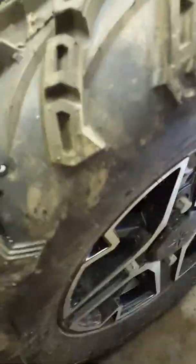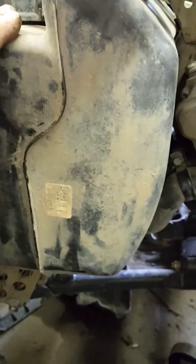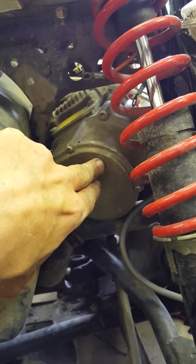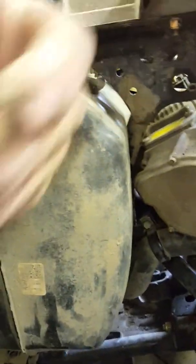I don't think I mentioned it in yesterday's video, but you definitely have to take the tire off. And when the gas tank is out, you have to pop the shock from the top — take the bolt off the top and just let it lean down. Otherwise you cannot get this part of the unit in. It's just ten times easier to actually snake it in this way.